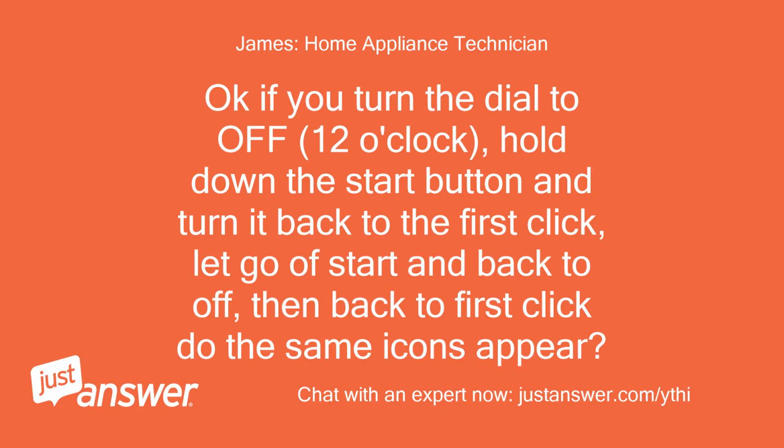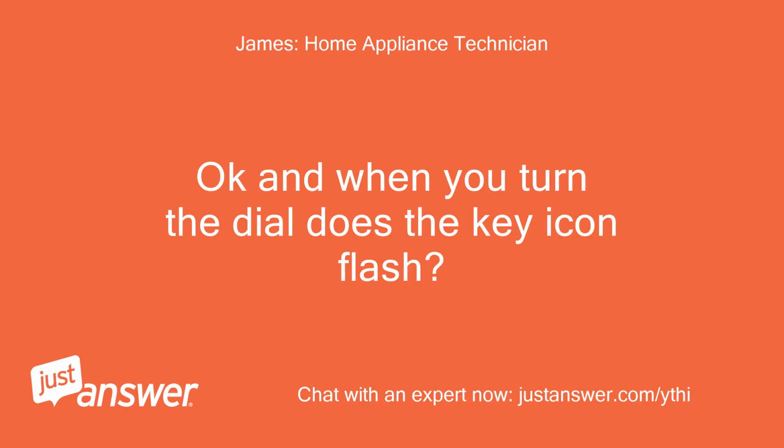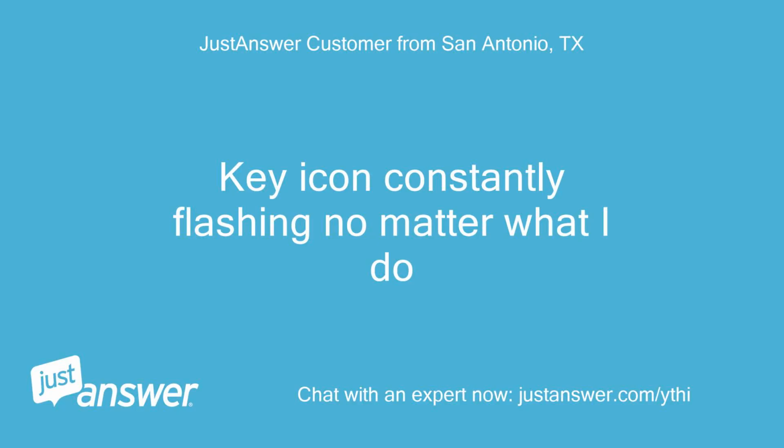Okay, if you turn the dial to off, 12 o'clock, hold down the start button and turn it back to the first click, let go of start and back to off, then back to first click. Do the same icons appear? No change. Okay, and when you turn the dial, does the key icon flash? Key icon constantly flashing no matter what I do.